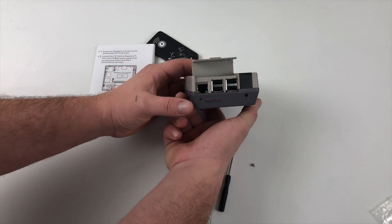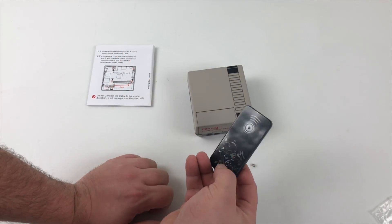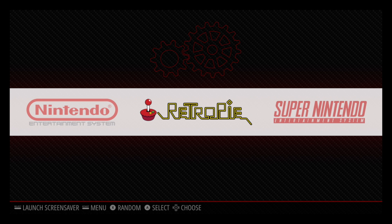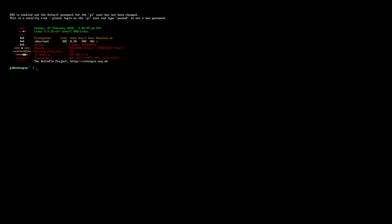And that's it — you got your Raspberry Pi installed. It's time to install the script so we can get the reset and power working and the IR remote. We're going to move over to the Raspberry Pi. I am running RetroPie 4.3. First thing you need to do is connect to the internet — if you're using Ethernet, plug it in; if you're using Wi-Fi, go into the Wi-Fi settings and connect to your network. You'll also need a keyboard plugged in. You can do this from an SSH application on Windows, Mac, or Linux, but I'm going to do it right here because the command is really short and easy to type. With your keyboard connected, press F4 at the emulation station menu — it'll bring us into the terminal. Now all we need to do is type this simple line out and press enter. It's on screen now and it's also in the booklet you received with the case.